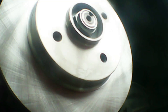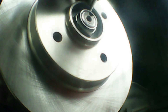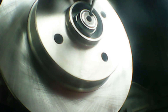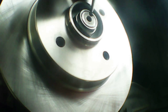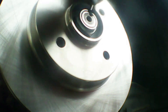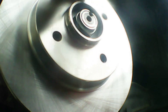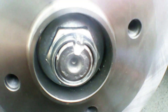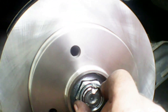The torque spec for this is 210 Nm — that's what it said on the box that came with the brake disc. Get it nice and tight. Now we're going to stake the nut in place — just use a screwdriver and a hammer and pound it down into the little groove. Just tap it down nicely — it makes a good indentation and holds it firmly. You can also use a punch for this, but I find the screwdriver is easier.